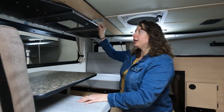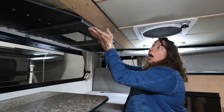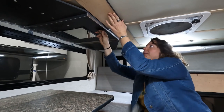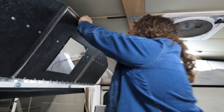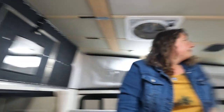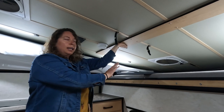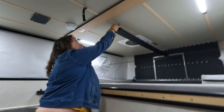Inside the camper, there is a latch that attaches the lift panel so it's not jiggling around while you're driving. Undo this latch to release the lift panel. I like to push up on the wood panel — you never want to push up on the roof area because that's where your insulation is. Push up on the wood area and then push up and out on the knob to lift the camper. Put one hand up on the wood panel to get leverage to push the front of the camper up, then it pops into place and you secure it.